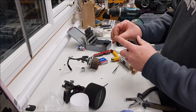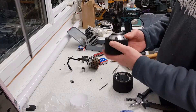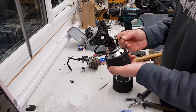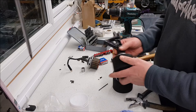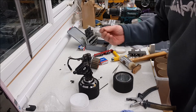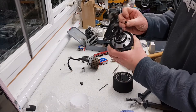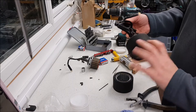This has taken me about an hour, so just be aware. When you undo these screws it might be a good idea to do it when you first get the board, because once they've been in a while the screws start corroding, making them even easier to damage. I looked inside this wheel about a year ago and this one came apart easier because I'd already undone them and never put the lock nut back - they stayed in fine. I'm going to replace them with cap head allen key 4mm stainless screws. I prefer an allen key end over a posi drive.